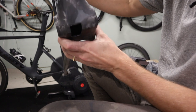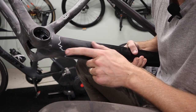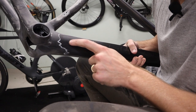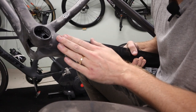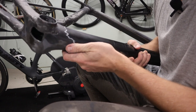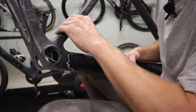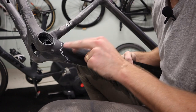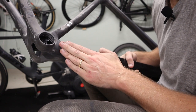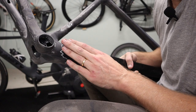The paint is coming off really nicely. Once you get through the clear coat and the base coat, you can see you go down into sort of a white edge, and it looks like you're through — but you're not really, because you still have the primer to go through. When it's wet it's really hard to see this. You also don't want to go too deep, because you don't want to go into the carbon and tear it down. Once I'm through the white parts, I stop with the heavy grit paper and go with a softer one.